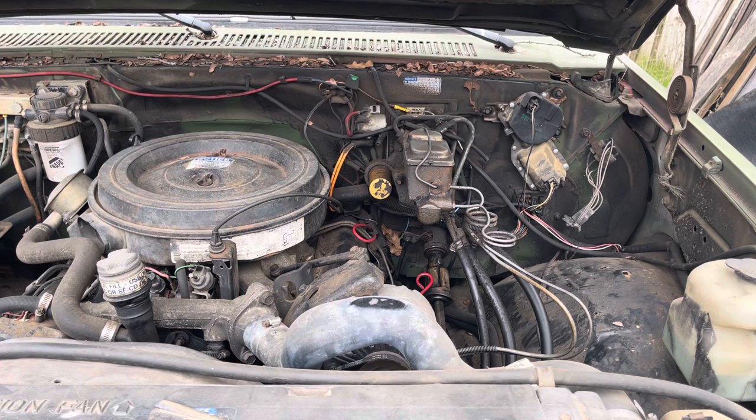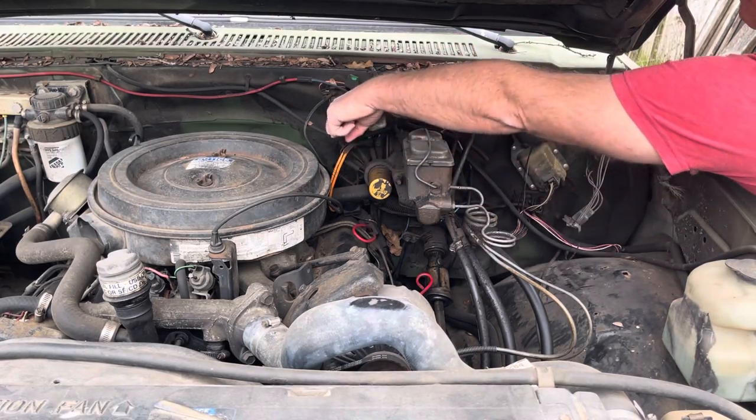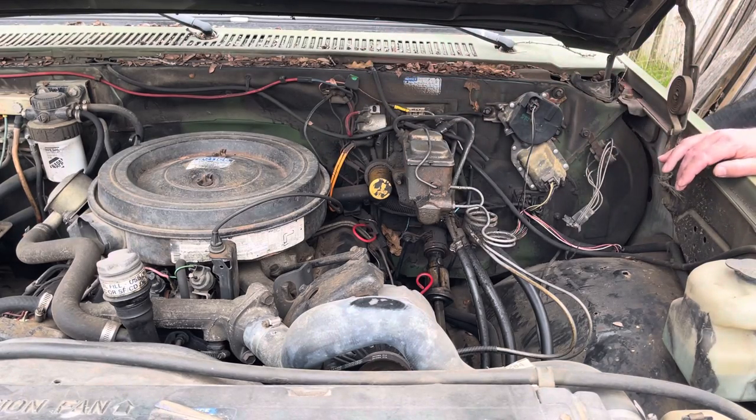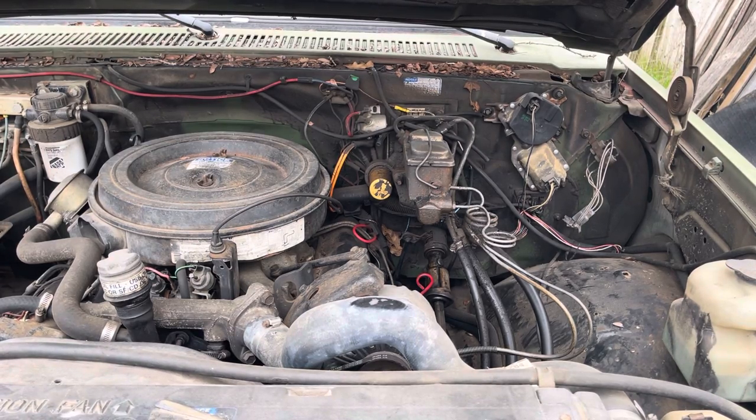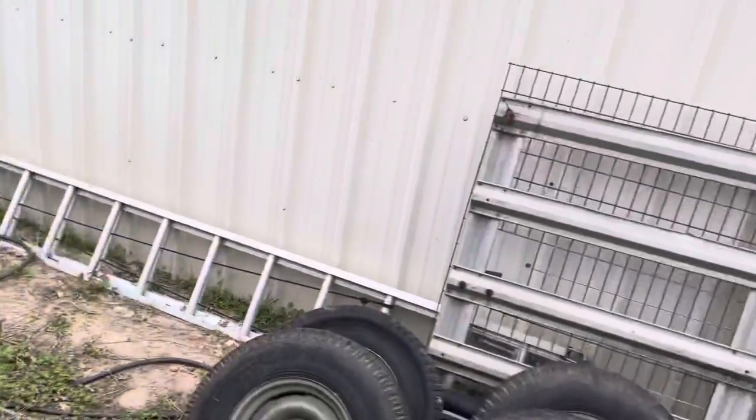What they replaced it with is a whole lot better — I'll talk about that in a minute. I'm showing you a CUCV 6.2 diesel, this is an 85-1009. You can see the glow plug relay. The orange wire is going to left and right glow plugs. Back here on the inside of the head is a sensor that plugs into the water jacket on the cylinder head, on the same spot as the octopus was. That senses the temperature and sends it all to a computer-controlled circuit board.